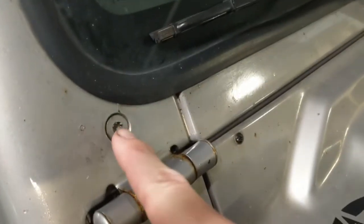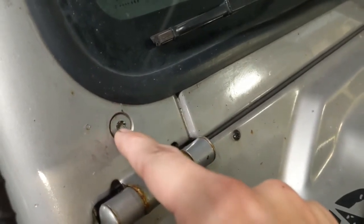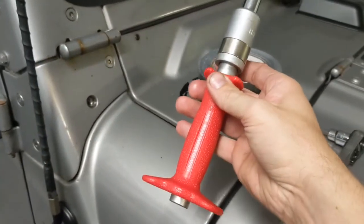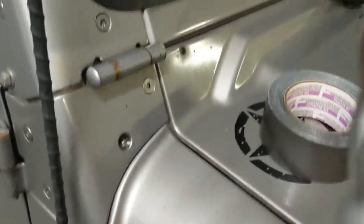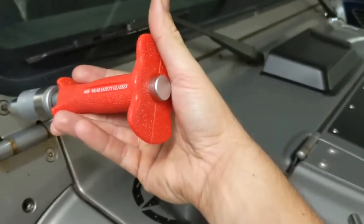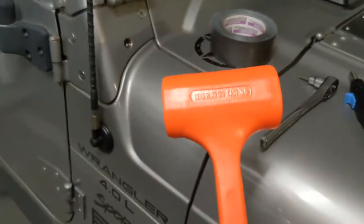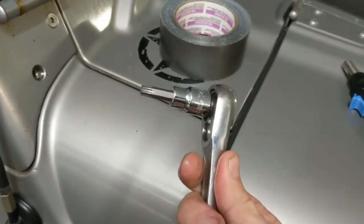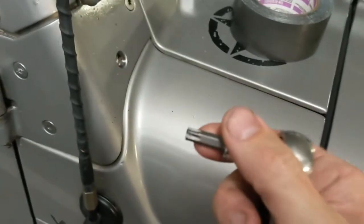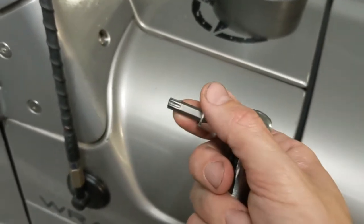Then I take my butane soldering iron with the tip off and hold that flame up to it — I'm getting it red hot. I try to focus the flame on the middle, hopefully the heat will move backwards as it heats up the bolt and melts the Loctite. Then I take my hammer drill bit — I got this on Amazon, I'll post a link below — it's a 5/16ths T40 bit. I line that up in the hole after I heat it up and pound it about 20 times with this hammer as hard as I can. That's worked for the last three, then I finish the job with this impact wrench, really focusing on not bending the torx bit, because on a few other bolts I've actually broken the torx bit — that's how stuck these things are.